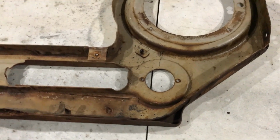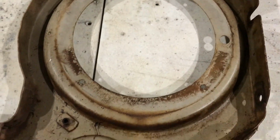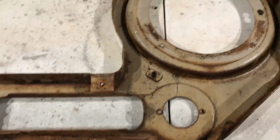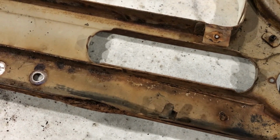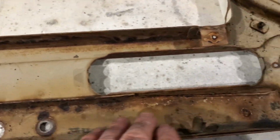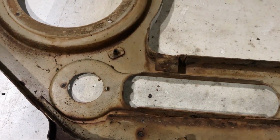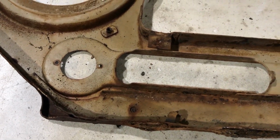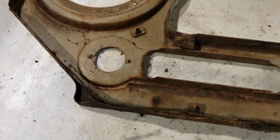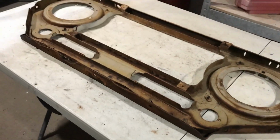Throw it in the molasses bath and it gets in everywhere. It gets all the rust out. It's bloody great. Good for these sandwiched pieces because it gets in there and cleans it right up. You can get the phosphoric acid sprayed on afterwards, and then I just think it's fantastic. And if you seal it, well, I can't see it rusting again at all, as long as it's sealed. No oxygen, no rust. Anyway, that's what we're up to.